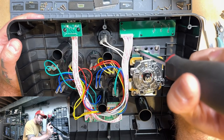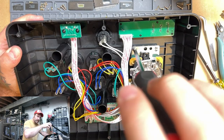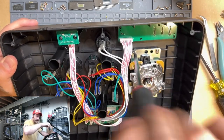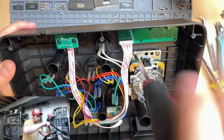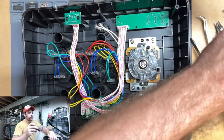When you put your screw in, first thing you want to do is rotate counterclockwise until you feel a click right there. You can even hear it. And then you rotate and go ahead and screw it in. That's basically going to line the threads up exactly with your screw hole. Just a good practice to do.